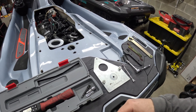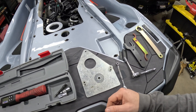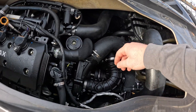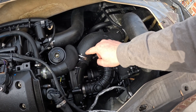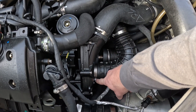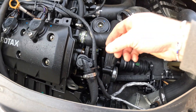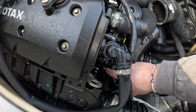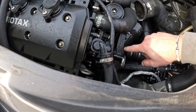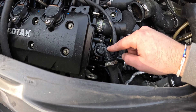Once we have it out, we'll bring it over. If we need to make any adjustments we'll use around a 17mm socket. Let's get the tools outside and get started. We need to remove the supercharger outlet hose - you don't have to remove it from the intercooler side, just the outlet on the supercharger - and then the supply hose. Get those two out of the way first. Next we're going to remove the crankcase vent. You can do this without removing it, but it's a real pain to get to that bolt on the back side of the supercharger, so I find it easier to just remove it.